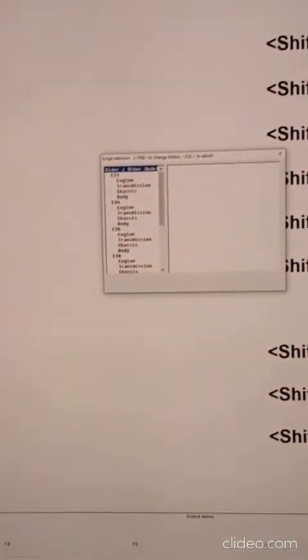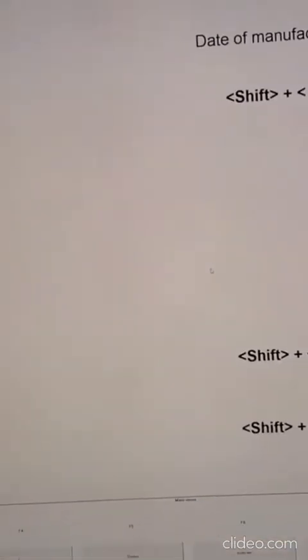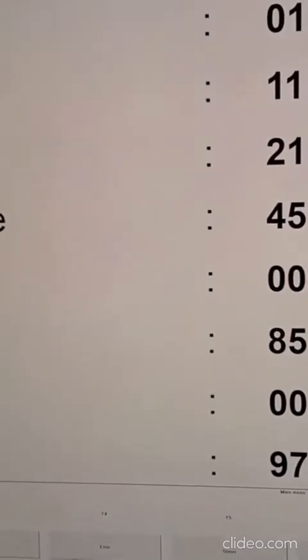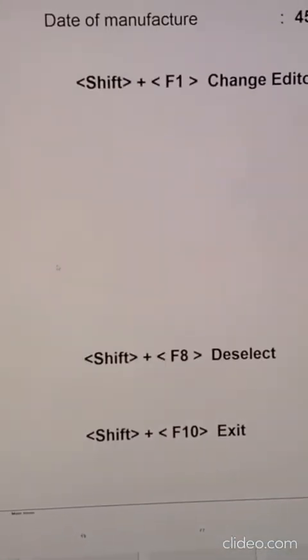Once powered on, start up the software — double click on E39 engine — and boom, here we go. You get all the screens and all the options and everything works: F1, F2, and you can do whatever you want, other than testing the components on the vehicle because they're not connected. That's all you have to do to bench test your module — take it out of the vehicle and test it in your house.